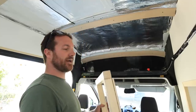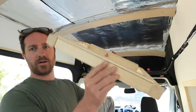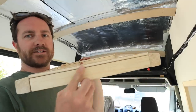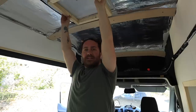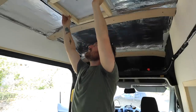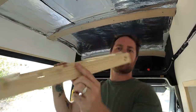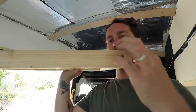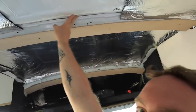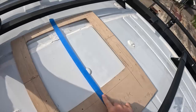Because the roof up here is really uneven, on this frame that I've built I've actually put a spacer in here with just a bit of ply. When the fan is fitted and screwed through, it's not going to pull the roof in any section. The slightly lower bit will be for where this ridge is, and then the other bit will sit in that gully — that's my theory anyway, it should work. So now all there is to do is cut the hole in the roof.